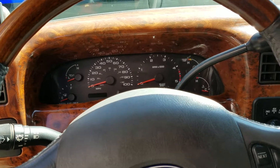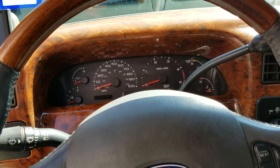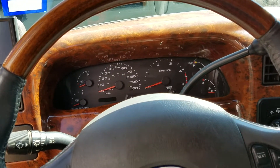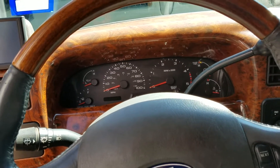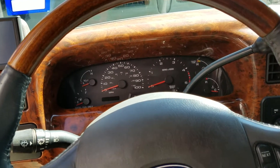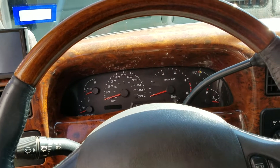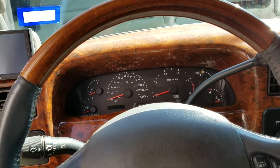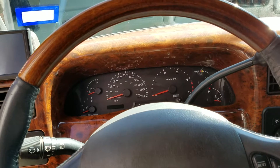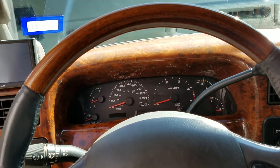The RPMs are dead on, works great. I've actually just finished designing a smaller, much less expensive board — it doesn't have all those expensive connectors — for doing tach-only without a tone wheel, just using the factory 12-valve with the two notches on the balancer and the factory Hall effect sensor. It should also be applicable to 24-valves and common rails, although I don't have any to test on. It's very similar technology, just more teeth and a gap in the teeth.